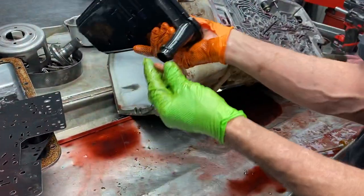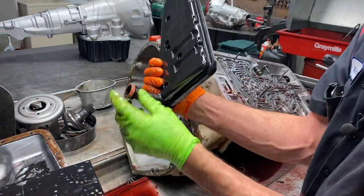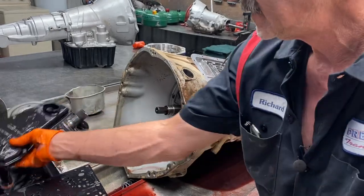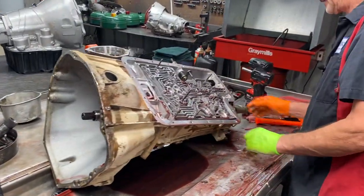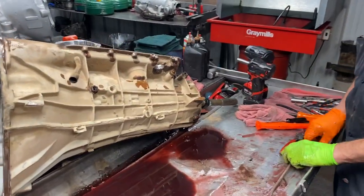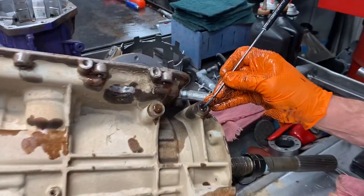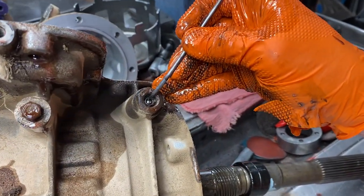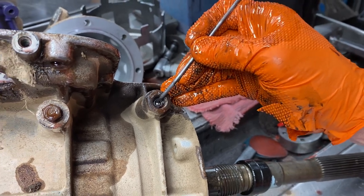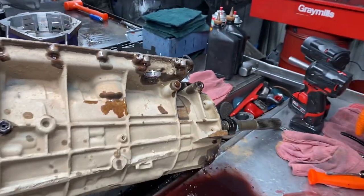This is your ring that seals your filter in - it'll be on your new filter. Always pull it out when you do your service. If not, you can break the neck off when you put your pan on if you double stack that. This valve right here is like a drain back valve - you can see right here it's a ball in spring. You always want to take that apart and clean it, make sure that spring's not broken, that ball's floating good. Because if that ball ever gets jammed up in there, you're going to lose lubrication going back to this planet - just cook it.